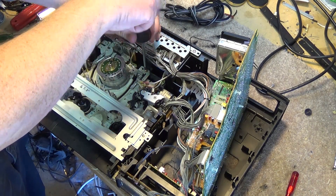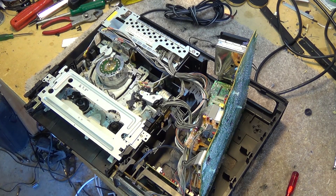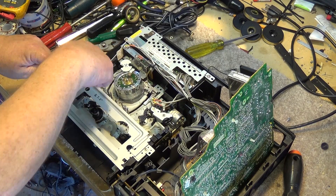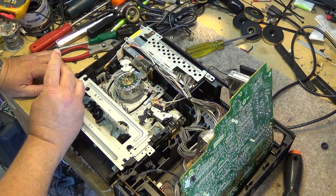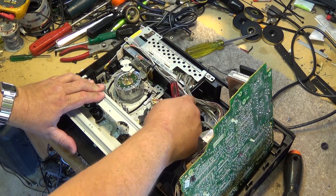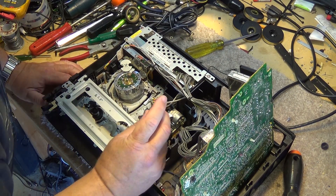We're going to release a couple of screws here so that we can remove the chassis and lift this whole unit out to be worked on as a separate piece. In order to pull the chassis, in addition to removing the one screw at the back, we also have to remove the four screws that hold down the cassette assembly. If you've got a tape jammed, you can turn this gear down here to eject the tape - push the gear back in that direction to get the tape out.